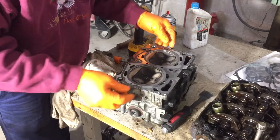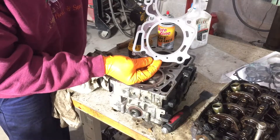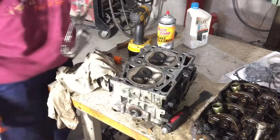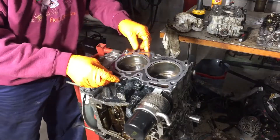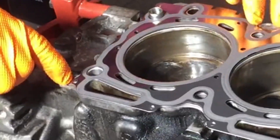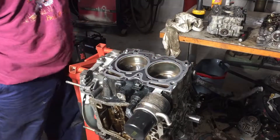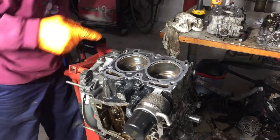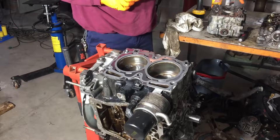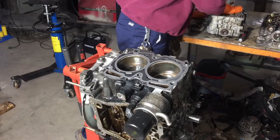There's no front or back — you just have to make sure all the ports are lined up. The gaskets weren't marked, but it's pretty easy with the layout of the holes. These dimples go in here, and there are pins. The elongated ports are to the bottom. Let's get this head on here.